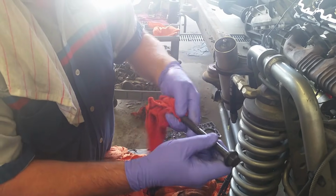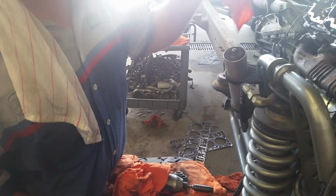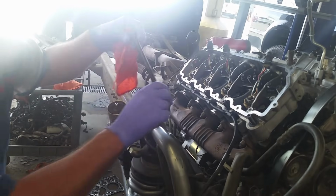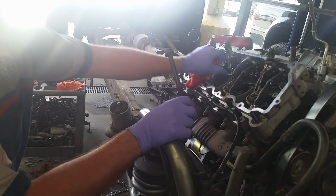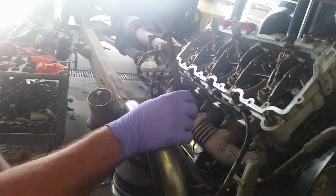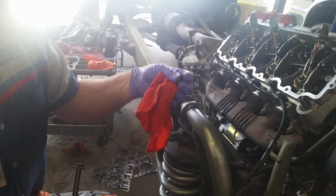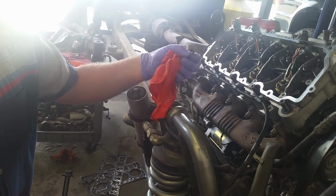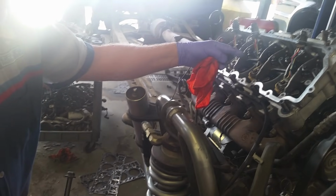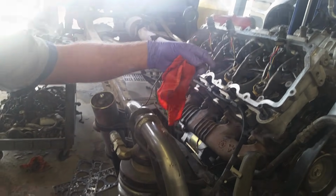That's why they say just get a rag that's soaked with it and put some lubrication on it there and up here. And when you install it inside the head, as you torque it down, you don't want these two surfaces dry and give you problems. We're using the studs, so I'm going to take some anti-seize. And again, I know the book says not to use anti-seize, but I'm going to take some anti-seize and put it on both sides of the washer so it doesn't grip either here or on the bolt, and also around the threads, and install the head bolts.